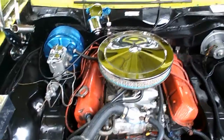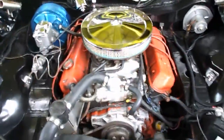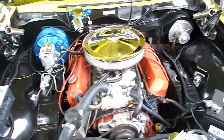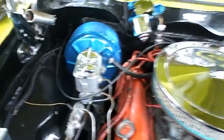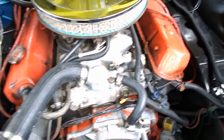I'll pop the hood — life in the hood is hard. It's a '76, I bought it from a car dealer who told me it wasn't an original SLR but it is — I checked the tags. They told me it was a 253, it's actually a 308. I looked underneath and it had a Ford 9-inch as well. I got it back in '98 and from then to now all I've done is spend money into it with all sorts of bling. The cam is only mild, Group A spec.